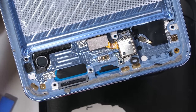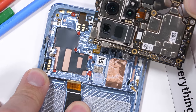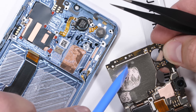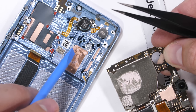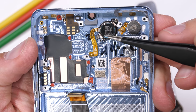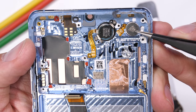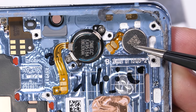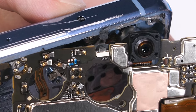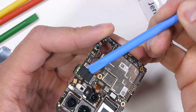Let's check out the motherboard and its 5 cameras — 6 total if you count the optical fingerprint scanner. With the motherboard out of the frame, we immediately see two circular vibrators and a lot of thermal paste over a rectangular copper inlay. It's not a heat pipe, but it's still better at absorbing heat than bare aluminum. The larger vibrator in the center is actually the earpiece — what Huawei calls electromagnetic sound levitation — projecting sound through the screen, while the smaller one handles notification vibrations. There is also an infrared LED built into the motherboard that controls TVs and other remote-controlled tech.